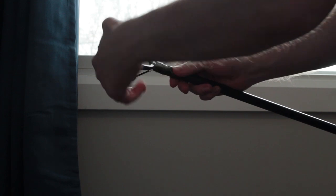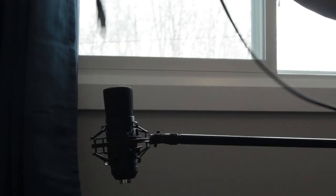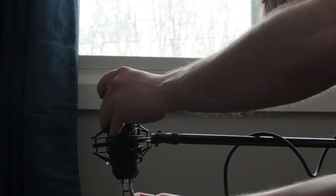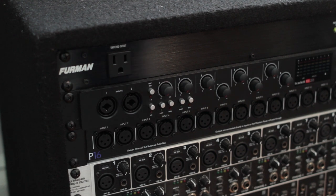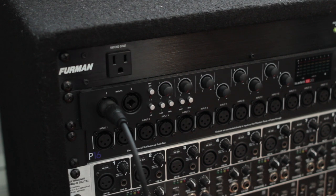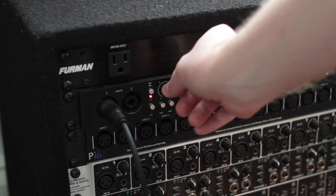To get this all set up, we just connect the shock mount to the stand, squeeze the shock mount to allow it to open and clamp the microphone, then connect the XLR cable to the microphone and the audio interface. When you're connecting the shock mount, you'll notice an adapter inside that you can unscrew to remove. This just lets it attach to different stand mounts, but you won't need to use it for a regular microphone stand. On the audio interface, turn on phantom power since this is a condenser microphone and it needs it to work, and then set the level. I've found this microphone to have a pretty high output without very much noise at all, so it doesn't really need that high of a preamp level to get it going.